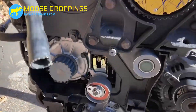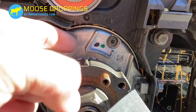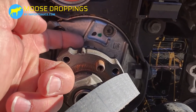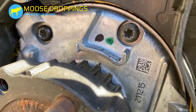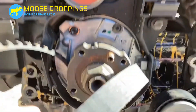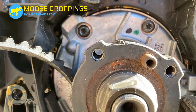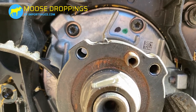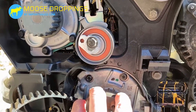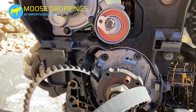If your crank pulley's off, you will see that the oil pump has a little notch here — 12 o'clock up and down on this little U-shaped guy. You can see it's a little elevated, and there's a mark that's going to line up with it. That will let you know that the crank is at top dead center. The oil pump does not spin, so this mark is stationary and this will want to line up with that.